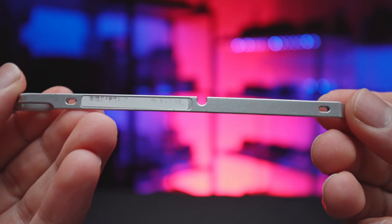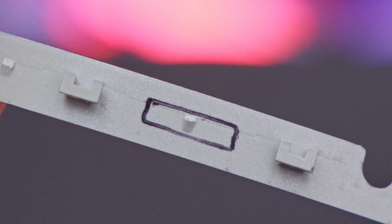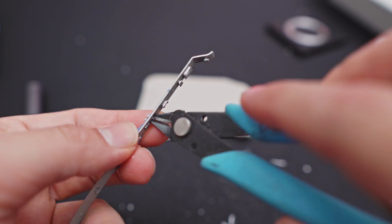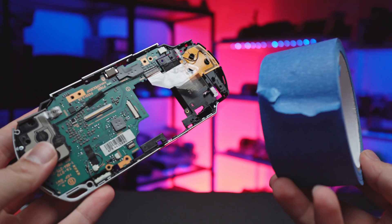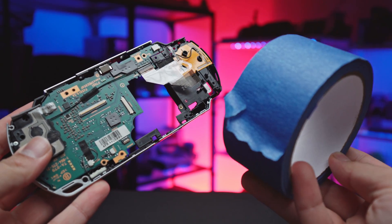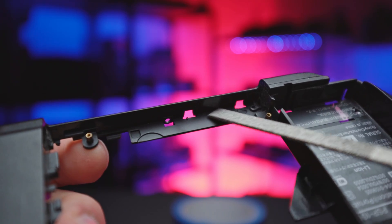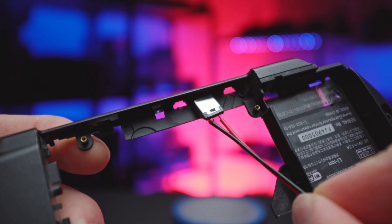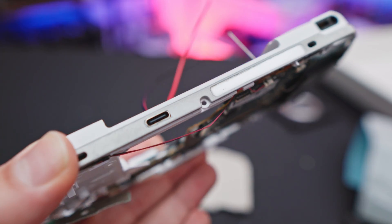Once done, move on to the trim piece. Put it back on, flip it, and with a fine marker draw the outline of your port to use as a template. Drill three holes, cut it out with snip cutters, and put it back on before filing. Grab some masking tape — which is made out of paper — apply it to the trim piece and start filing. Start from the bottom and make sure the trim piece and shell are perfectly flat in that area, as that is where the Type-C port will be sitting. Take your time, keep filing and checking until you have a clean cutout.